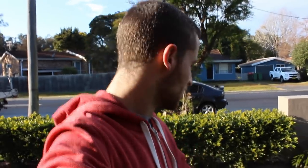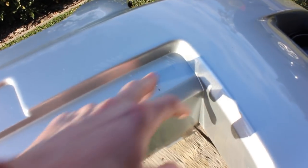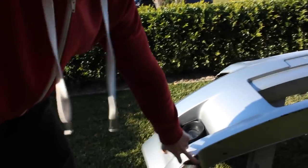I'm going to start sanding it up, then we're going to putty it and sand it again and then we can finally get into the painting. My idea is to sand this little bit here, sand under there to get rid of the dags, sand all along where it's scraped and do a little bit there where the dent is from the tow bar — that's everywhere I'm going to spray putty. I'm hoping I can build up a little bit to make it how it used to be, but I'm not 100% sure if the spray putty will do that.